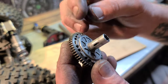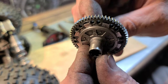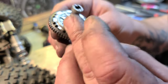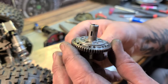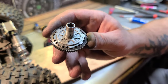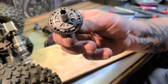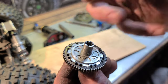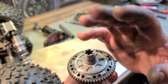And then I'm going to think about getting a whole new set of Hot Racing clutch pads and new hubs, which I already got the hubs. I just need a new set of pads. Got a brand new set of hubs already. But I don't think I'll go back to the stock configuration. I think I'm going to stick with the Hot Racing. I would rather replace worn out pads every 6 months than have to replace these hubs every couple weeks. And it's less headache. So, like I said, even after opening it up and seeing how much, I wouldn't say damage, but wear is on the hub and clutch pads,